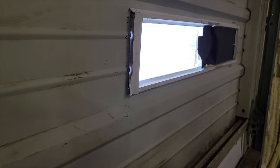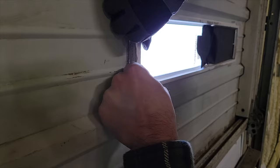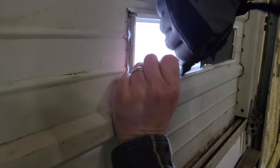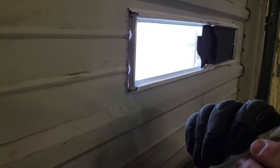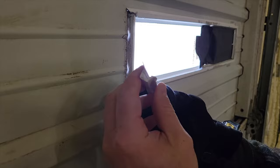I was really working at it, even used my hands and got smart using a glove around that glass, and it just refused to budge until I manhandled it and pulled it off — but pretty much ruined this piece of trim in the process. As you can see, there are two rows of teeth on each side of that piece of trim and also on the window frame that it attaches to, and those little teeth kind of grip on there. The way I was approaching it really did it no favors.